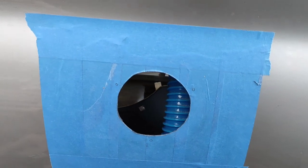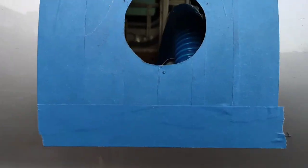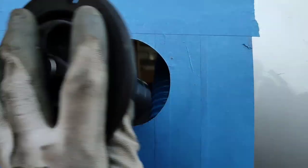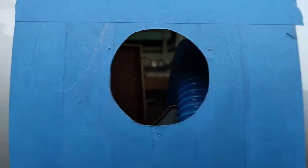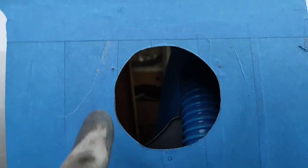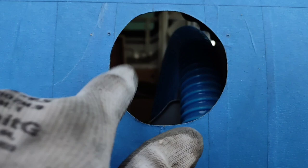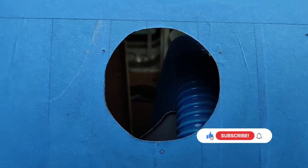Other than a slight false start where I snapped the first blade, that went really well. This fits nicely so I'm going to put some mastic on the back of this, put an extra bit on here and here where it's slightly curved out, and then pre-drill these three holes. I've drilled the three holes, then I just need to put a bit of hammerite around the edge to protect the bare metal and then I can attach the screws.